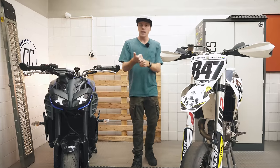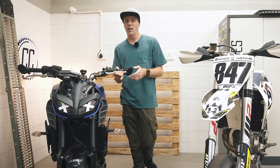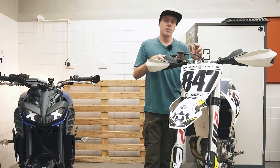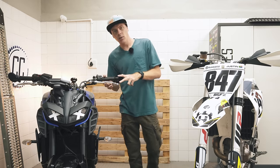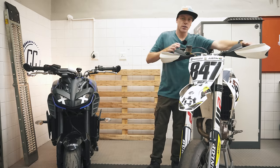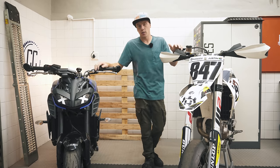But if you take money and maintenance out of the equation, it all comes down to personal preference. Personally, I still prefer a cable clutch because it offers better feeling and feedback, at least in my opinion. A hydraulic clutch might be lighter to pull, but it doesn't feel as connected to the clutch. A cable clutch feels slightly different throughout the pull, giving you more information to process, whereas a hydraulic clutch feels very consistent throughout the pull but feels less connected. But you may prefer that — it's all personal preference.